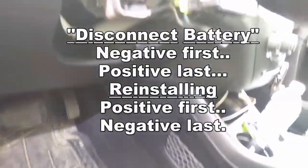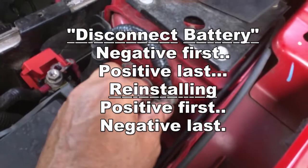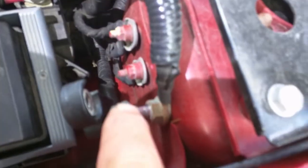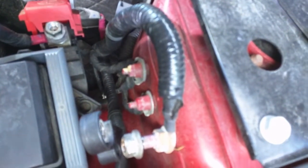To get this off, you need to first disconnect. Take the ground wire off first, which is right here. Make sure that that's off. Then you can take the positive wire off — right there — and I believe that's 15 millimeter. Disconnect the negative first, positive last. Hook the positive up first when you hook it back up, and the negative last. Always last for negative.